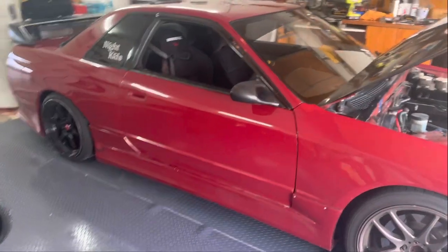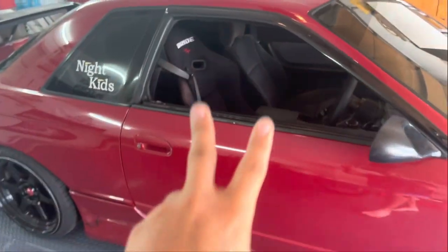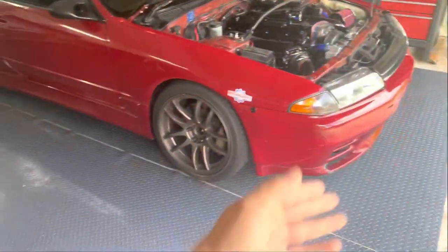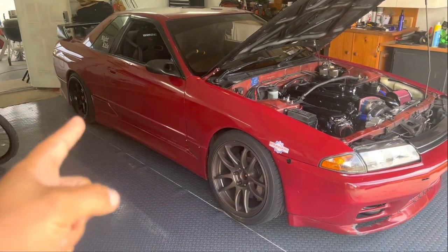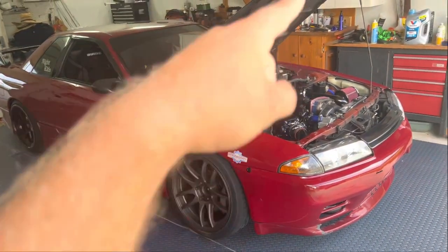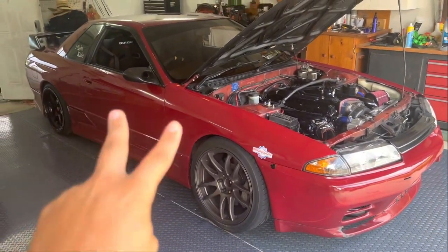Okay, and now we're back. The car did pretty good, but I ran into two problems. This car never stops — you know how I feel about it. When we went to E85, this car wants to make a ton of power. It makes funny noises in the engine but still wants to make power. On E85 it wants to run more boost, but the fuel pump can't keep up with that boost. And we can't turn the boost down because the internal wastegate will not let enough air out. So I have two problems.